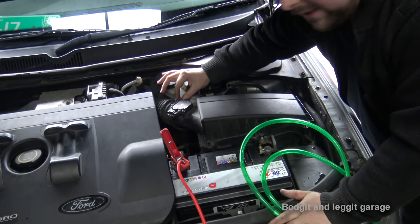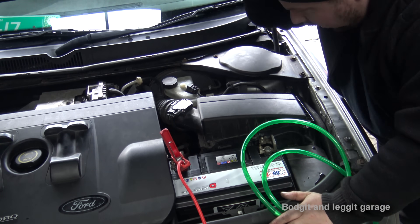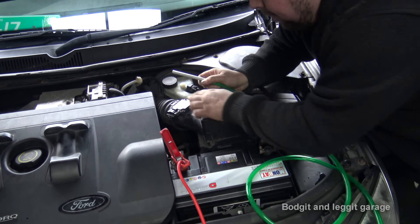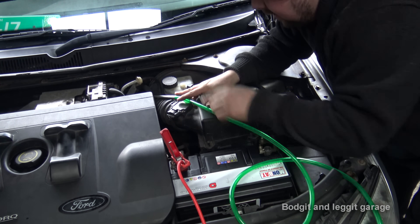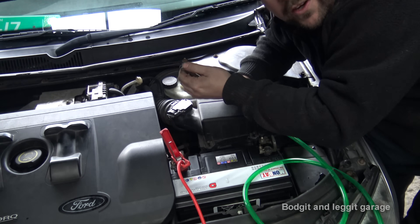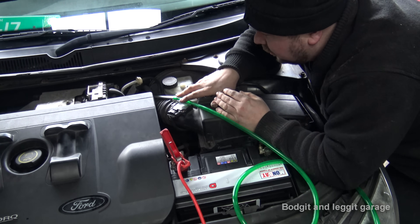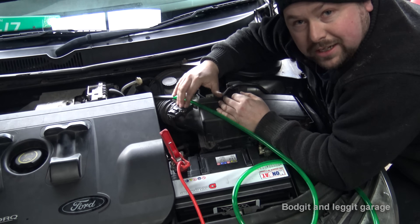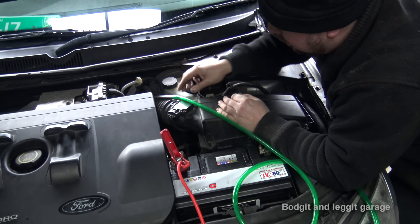Now we're going to show you on this particular vehicle where I'm putting the hose. On this one I would normally just take the intake pipe off and put the hose in, but I'm going to put this pipe in past the sensor — you don't want to put it before the sensor. I'm connected directly to the turbo so you don't want to go too far in either or the turbo will hit the pipe. On a Toyota I did once, disconnecting the pipe gave us an engine light because the computer was reading funny, but we could still clean it, put the pipe back, and clear the faults — no problem.